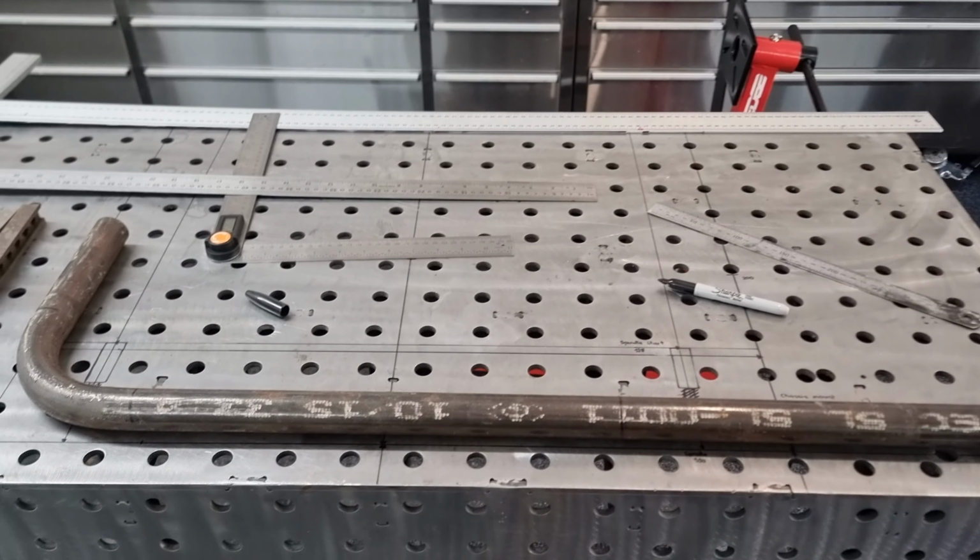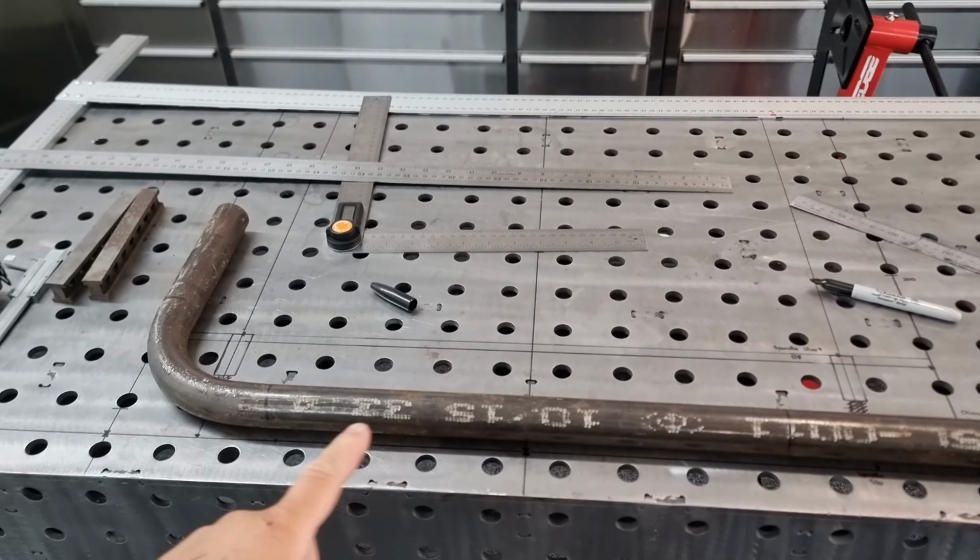First I'm using a tube bender, so we've done a practice 90, so we use the test piece first. So I'll do another 90 and hopefully it lands exactly where we want it to. And if that's the case, then we can run with those dimensions. If not, then we'll have to keep fine tuning it until we get it bang on. Here goes our first test piece.